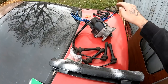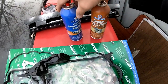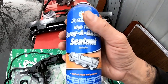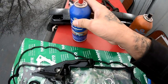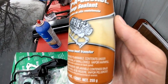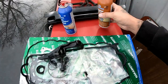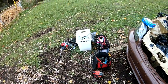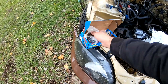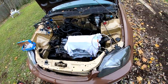Then I got the torque wrench because we're gonna have to torque everything down. I got the distributor ready and the new wires. I have two kinds of sprays — this one I like to use on any paper gaskets; it makes the surface tacky on both sides and creates a great seal. For the head gasket, we're gonna use this stuff right here. I'll probably spray one coat, let it dry, and then spray a second coat on both sides.